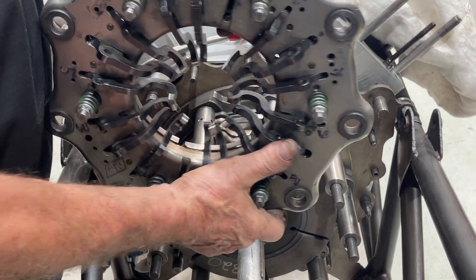So that's the way it is — you get a 40- or 50-thou gap, whatever you're comfortable with. You pull this dummy shaft out and put your real shaft back in there, then you put your clutch can on the back. Unfortunately we haven't got a clutch can here at the moment — the can bolts onto the back of the clutch, and the reverser bolts onto the back of there. That's for another day.